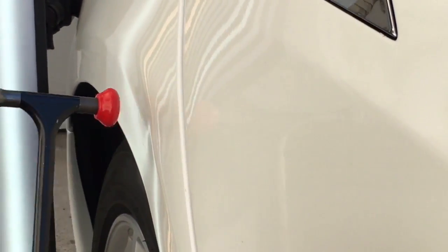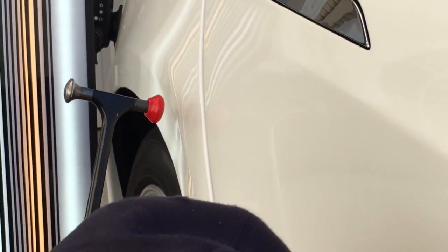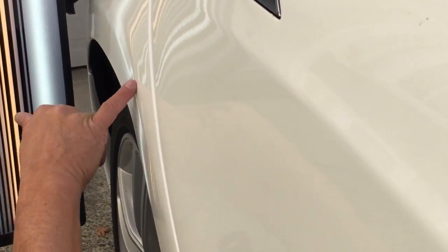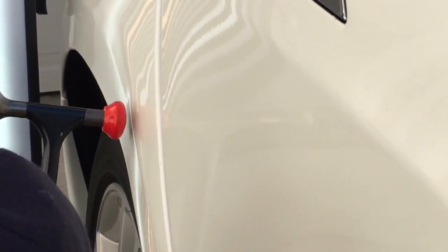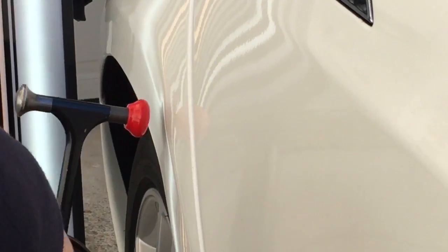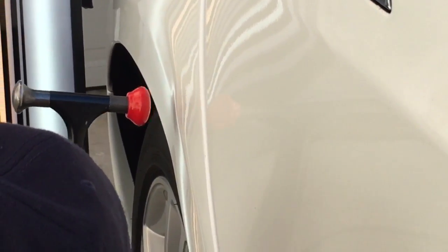At this point in the video I sure do appreciate everybody clicking on this video — I really do. We do have a microphone on today so hopefully the sound sounds pretty good. It's a beautiful day, we're out in the field. I'm getting real tight in here basically breaking this little brow down right at the most severe point, which is right here. Baby taps, about two pounds of pressure — not really throwing this hammer down hard, just kind of letting it fall.